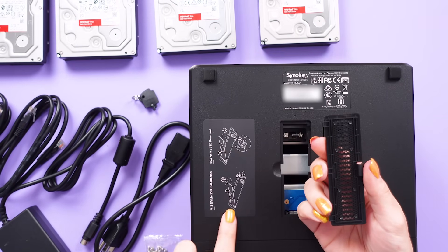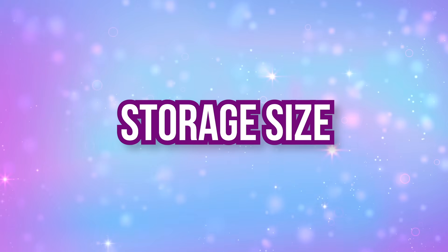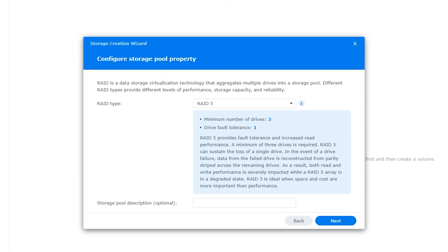Next is choosing your hard drives, and this comes down to a few important factors. NAS-dedicated drives are rated for continuous use, and they will last longer than your regular consumer PC drives. The PC drive in my gaming tower is not being accessed 24/7, but a NAS drive will be reading and writing at a much greater scale, so stick to NAS-rated drives. RPM and cache is important — a 7200 RPM drive means the disk is literally spinning faster, so you will get faster performance than on a 5400 RPM drive. 5400 RPM drives can be more efficient though, so look at the quality of the drives and compare lifetimes and warranties as well. If your NAS has space for an SSD cache drive, you can use SSD caching for memory-dependent tasks like file sharing. Storage size is a definite must — consider how much space you will need for several years down the line. If you are using a RAID, you will also need to consider how much storage you actually need, because the amount that you buy might be halved because of that mirroring.